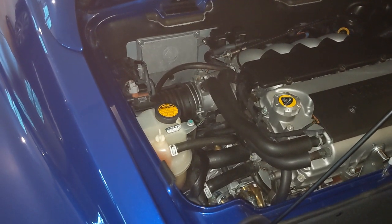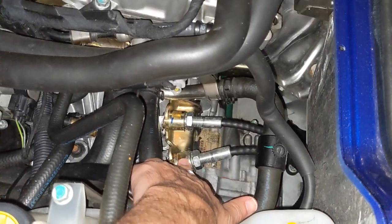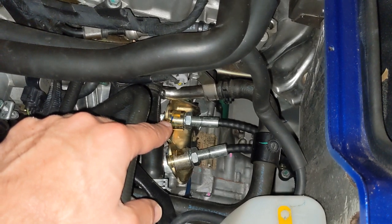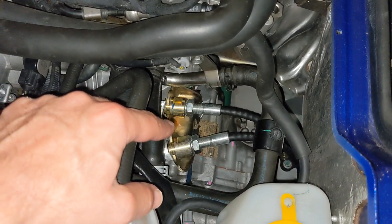So I came to believe that the buzzing may have been coming from the cable sheath itself — the outer sheath of the cable transmitting vibrations from the engine where it's mounted into the shift console on the other end.